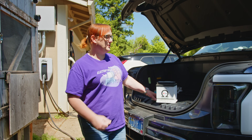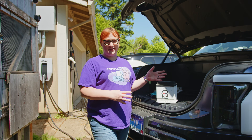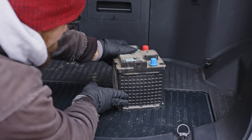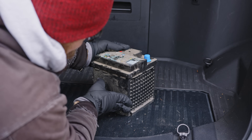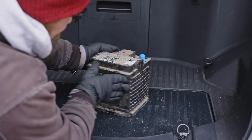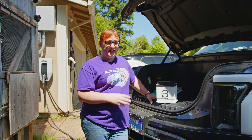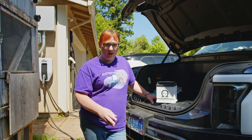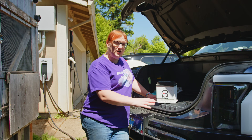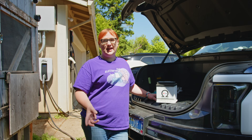When I replaced the battery, I explained in the original video that the 12-volt battery that came with the truck from the factory was on its way out — it wasn't storing charge properly and it was starting to show issues when I turned the truck on, saying it was in battery saver mode. It turns out there was a bug in the 12-volt battery management system on this truck — it was a problem across all similar model years of the F-150 Lightning, and Ford fixed it with an over-the-air update.